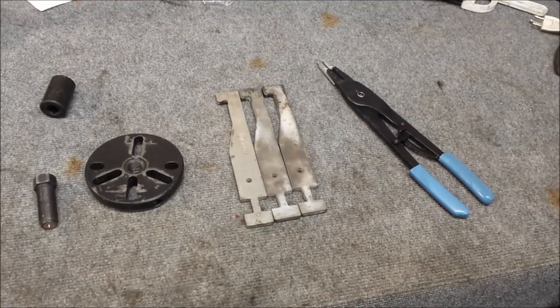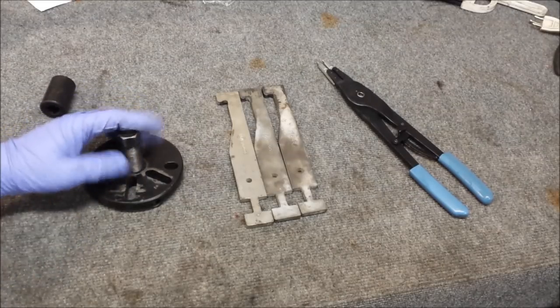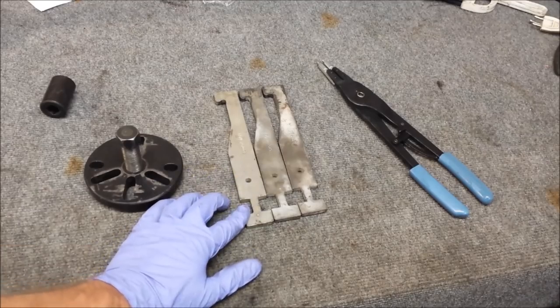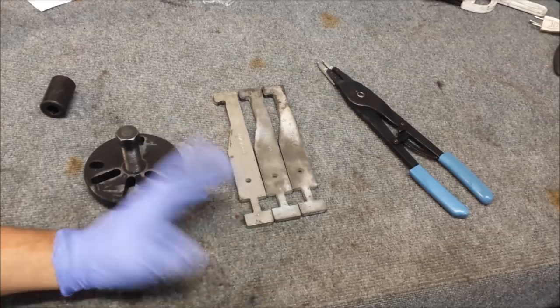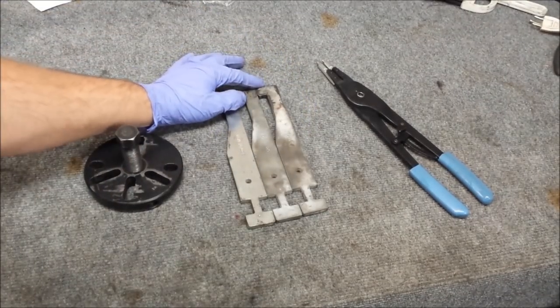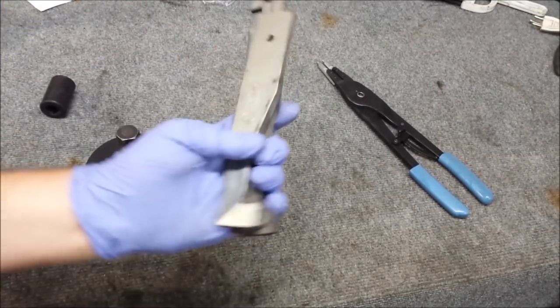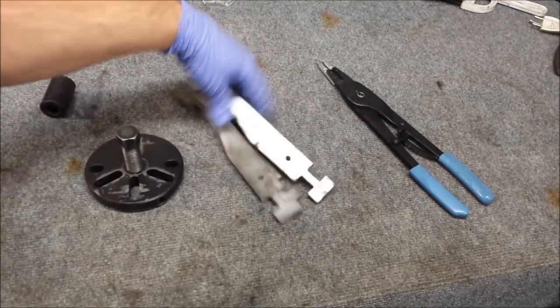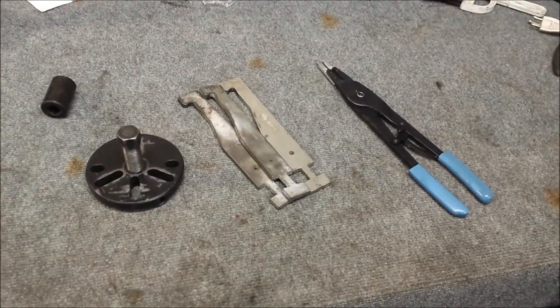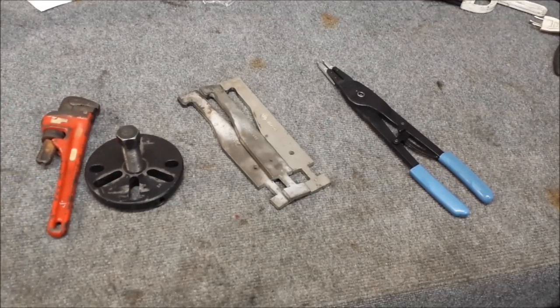My desk is already a little greasy. To do this repair we're going to need a few special tools: parts of the universal puller kit — just the puller and screw — and puller legs. These are sold individually, so you need three of them. I don't think they sell them new anymore, so you'd have to go on eBay and find used ones. You also need snap ring pliers. A driveshaft holding socket would normally be needed, but since somebody cut the driveshaft off, we're going to improvise and use a pipe wrench if needed.